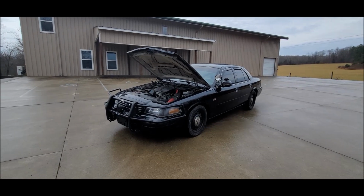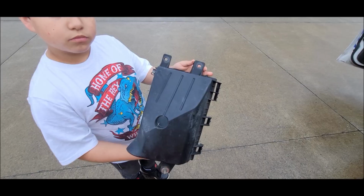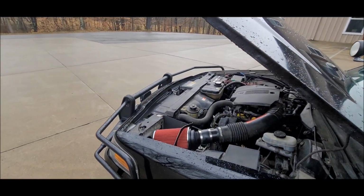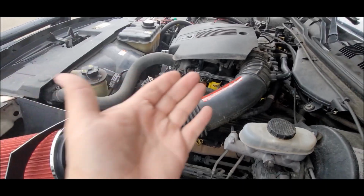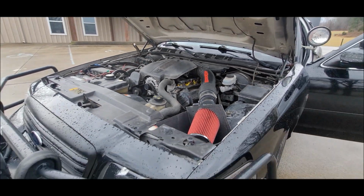Crazy. Now, reason number 3, numero tres, and that is a slight horsepower gain. All right, hear me out for a second, okay? These old 4.6 2-valves are usually suffocated by these super bulky heat shields. Removing it not only increases airflow, but the extra space and the combination of the open heat shield make the perfect combination for, at the very minimum, a horsepower gain of anywhere between 5 to 8 horsepower. At the very least, the increase in throttle response is worth it in my opinion alone.